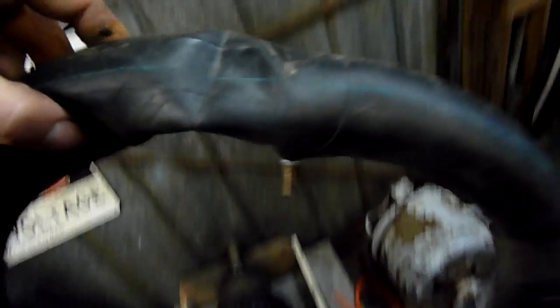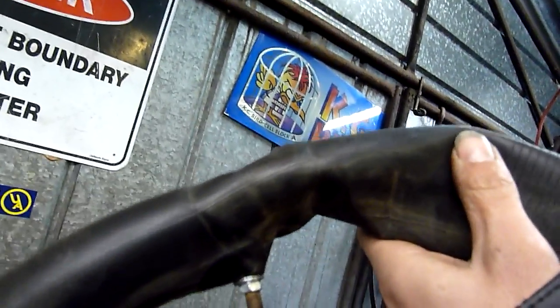It's actually very hard to get these in compared with car tyres and things — I could have done four car tyres in the amount of time it took to do this. But it's done and it's an extra heavy thick tube so it should last a lot longer. The problem with the old one was even though it had the right numbers stamped on it, I think its diameter was a bit bigger than it should have been, and it all bunched up inside — all those creases were from it being bunched up inside the tyre. So that's how that one failed. It's cracked rubbish.